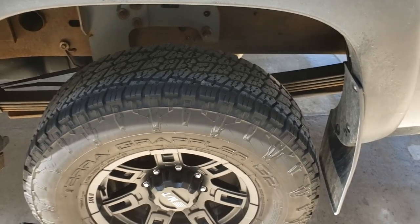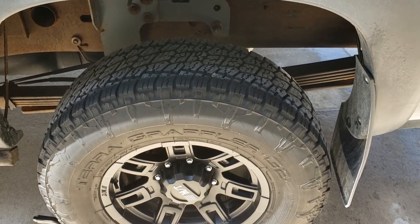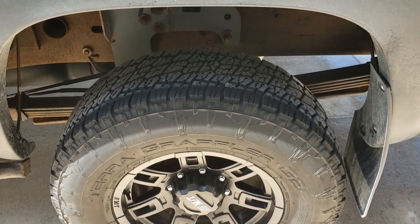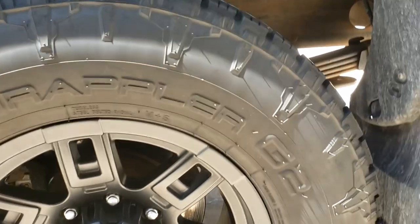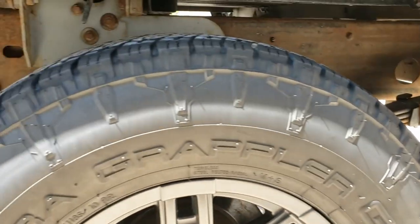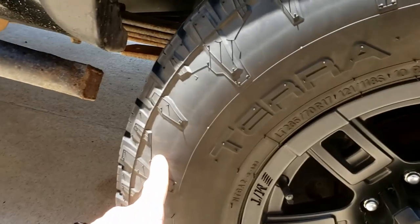Now I'm using Adam's Wheel and Tire, going undiluted on the left and on the right, I diluted it two parts Wheel and Tire Cleaner to one part water just to get it to flow a little bit better. I'm not noticing any difference in cleaning ability, and it's cleaning great — it's getting that browning off the outer perimeter that all these other chemicals have failed to remove.